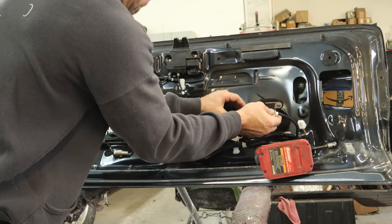Now we're going to pull off our Lexus emblem from our deck lid, which happens to be shaped like an oval, similar to the Toyota emblem — and it's actually for a reason. Some of these cars are sold as Toyotas in different parts of the world, so they make the same deck lid with the same cutout in the center and just put a different emblem in it. Toyota was thinking when they made their emblems. There are a couple of alignment pins on the back of this emblem, so we're going to go around it and hopefully not knock those alignment pins off, otherwise we're never going to know where this emblem goes.